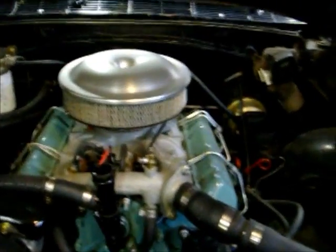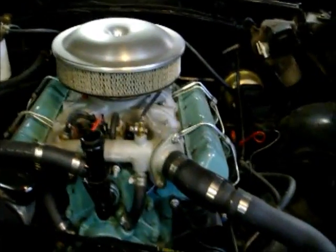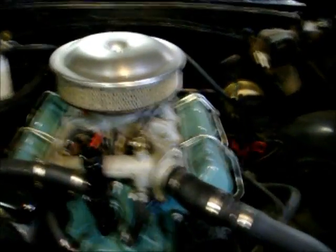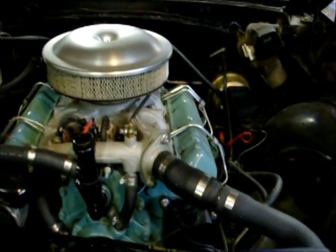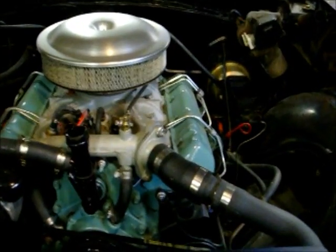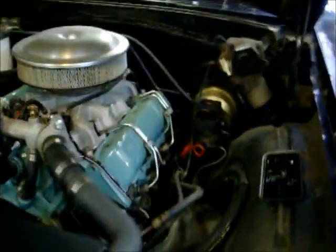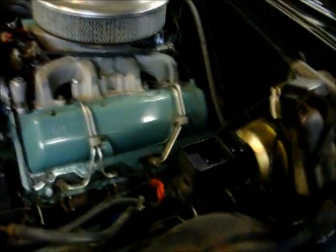Well, when you let drum brakes sit for a long time, it collects moisture, especially with the old brake fluid. It really collects moisture, and your wheel cylinders would free up or seize up, get rusty, and then moisture's in the system, and you're always rebuilding the system every spring, or you run into trouble. Where this stuff here, it doesn't attract moisture, or at least very little. And he goes, yeah, it's not cheap, but you do it once and you're good to go. Obviously you can't just take an old system and drain the brake fluid out and put the new stuff in. They don't recommend that at all. And most of my stuff I always start over from one end to the other, so it's all new. That's usually when I do it.